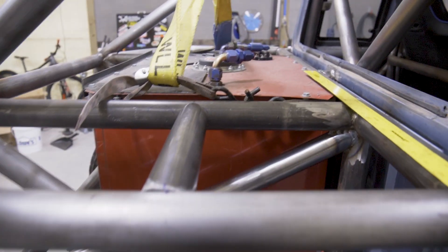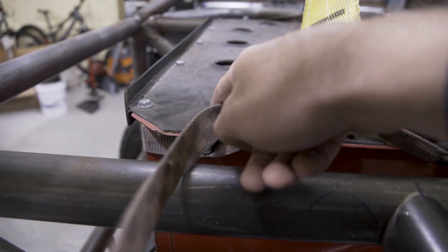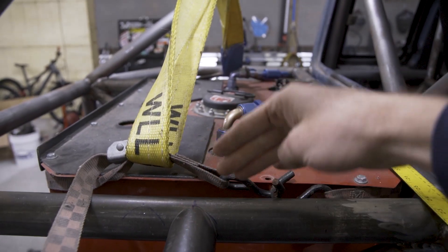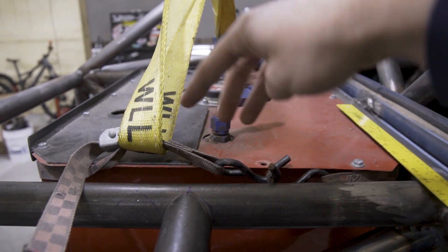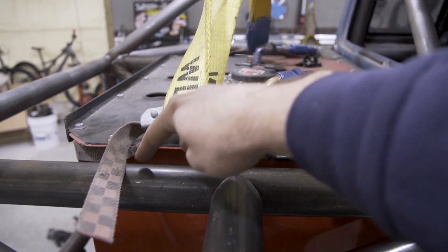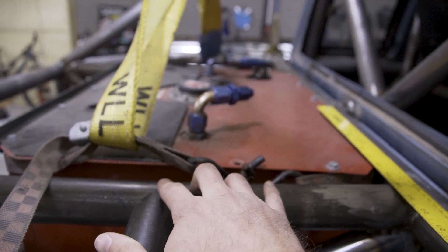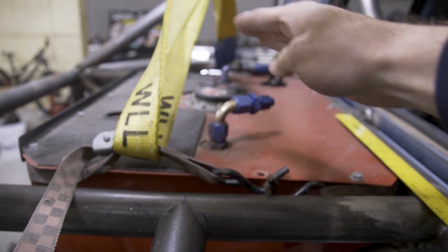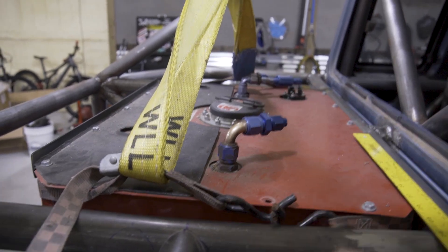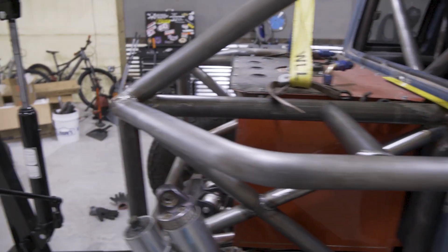We'll use those corner mounts to locate the cell forward, aft, and side to side. But the main thing is in a rollover — you don't want this thing toppling out. I'm going to build something similar to what I did the first time, but it will go across the center of the tank — basically make a strap out of plate steel that goes from one tube to the other. I'll do some welding bungs, probably three on each side, so plate steel goes directly across it and bolts there. With that strap going across the middle of the tank, it will be very strong and should mount really well.